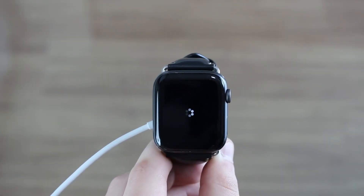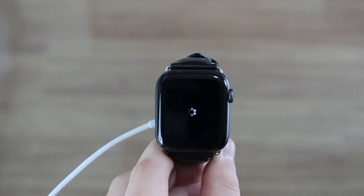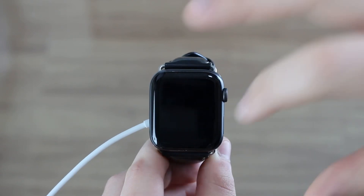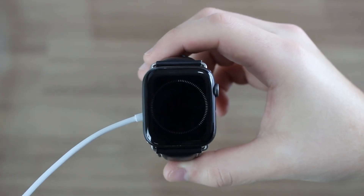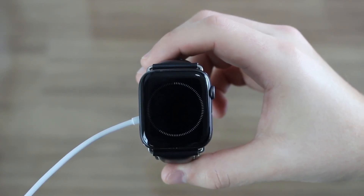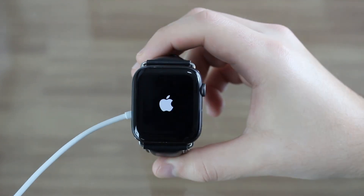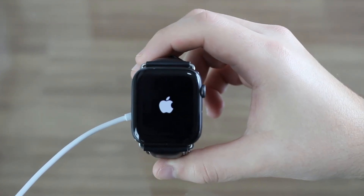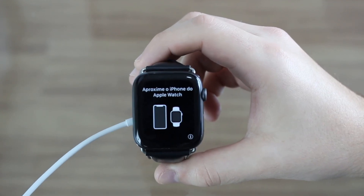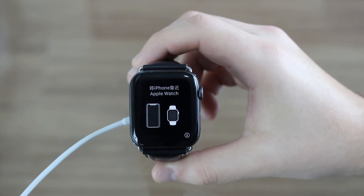Keep in mind that it's necessary to always leave your Apple Watch plugged in — plugged into the watch and plugged into the wall. It has to be charging throughout the whole process, otherwise you may run into problems. After a few seconds, it's going to automatically reboot with the Apple logo, then it's going to fill this circle, meaning the erase process is working. Another Apple logo appears as it restarts, and then you get your normal setup pairing screen.